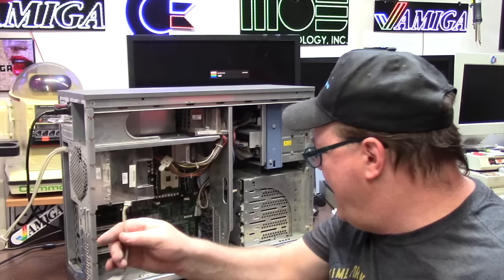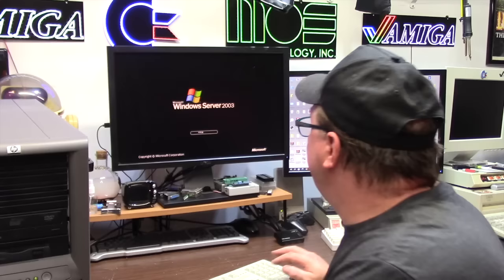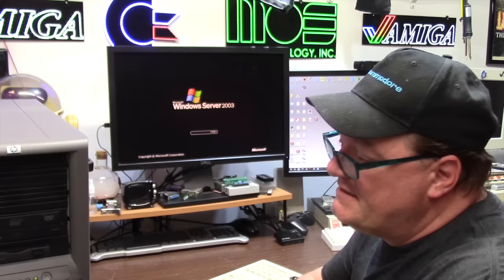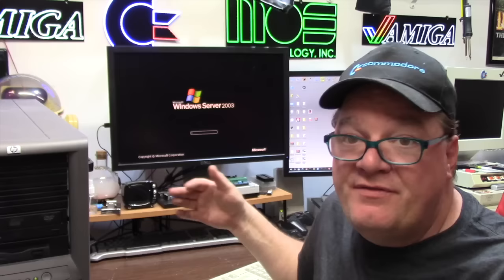I'm getting really dirty. I'm gonna put this down, because here it is. I told you it was from the 2003 era. So we're gonna let it boot. In the meantime, I'm probably gonna have to reinstall this. I don't know if it's the 64-bit or the 32-bit install. It's got 8 gigs of RAM, so it's either using physical address extension to get past the 4 gig limit of 32-bit. PAE, whatever, 8 gig, I forget these things.